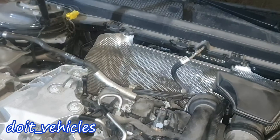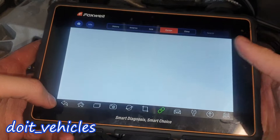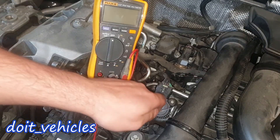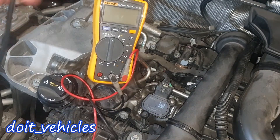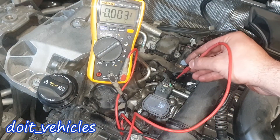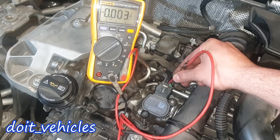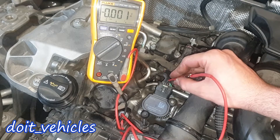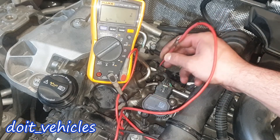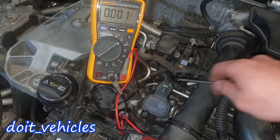I'm going to have the car battery on charge because I need to keep the ignition on. I've got the ignition on. Let me first check if I can see anything on the live data. There is no direct data PID which will indicate if this solenoid works. So let's connect the negative side of the voltmeter to ground and see what voltage we find. Starting with the first wire from the right: 12 volts. Second one: nothing. Middle one: 0.02 volts. Fourth one: 5 volts. Fifth wire: 12 volts again. Last wire from the left: 12.5 volts.